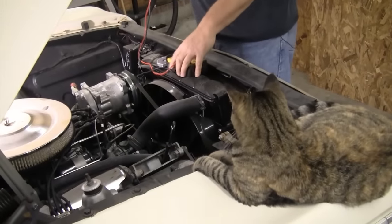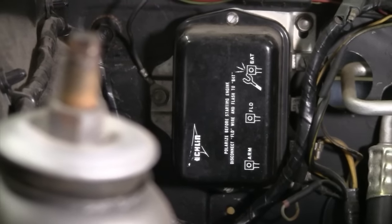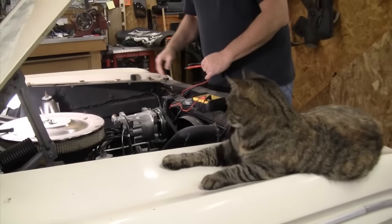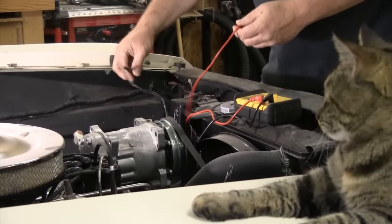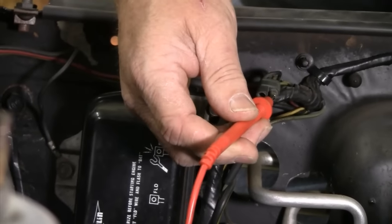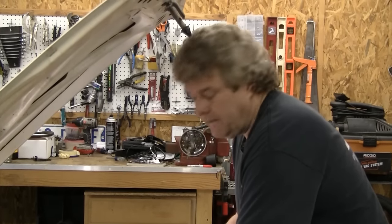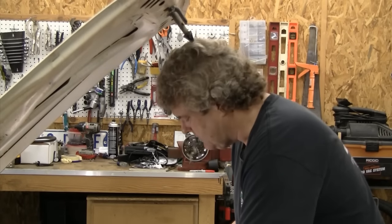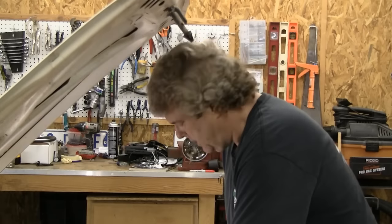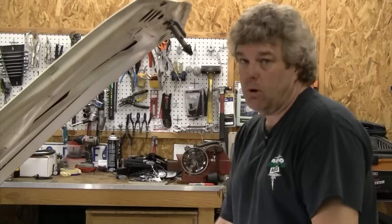Now, one of the grounds we've got is right here — this is for your headlights. When you run your headlights on the Ford, your marker lights also come on. We have the marker lights out of this car, so we're going to do a ground check and make sure we're good to go. Cam, turn on the lights. I'm going to ground to the battery and go to my ground lead on my plug here. We're running at about 0.05 volts — that's just fine. If you have half a volt, you've got a problem in your electrical system and you'll need to track that down. A 0.05 on the voltmeter and you're good to go. So the next thing I want to talk about is where some of these ground locations are — we've got the headlight ground up here, but there are a couple more I wanted to show you on the car.